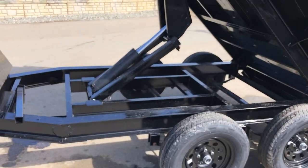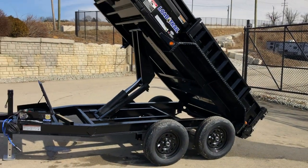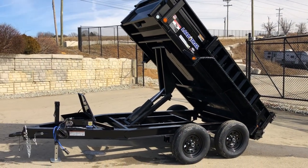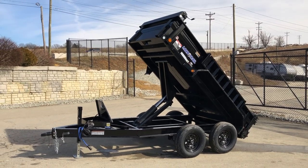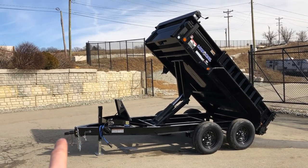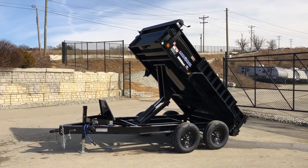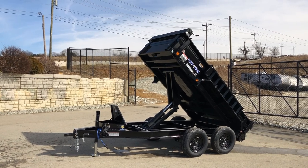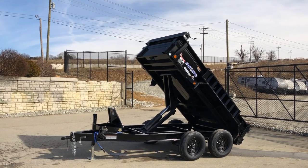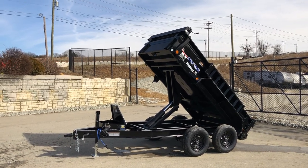It's going to get about a 45-degree dump angle. The trailer is going to weigh in at about 2,200 pounds empty, giving you a net legal payload of about 4,800 pounds, and then you're going to transfer your tongue weight to the truck side — that transfer tends to be about 15%, or about a thousand pounds. If you're perfect on both axles with an average tongue weight, you're going to net about 5,800 pounds of net legal payload.